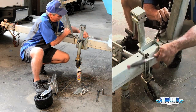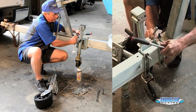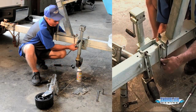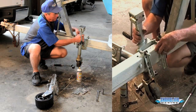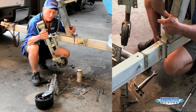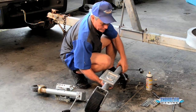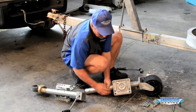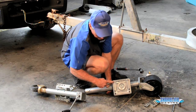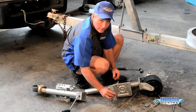Take the old one off — if you just loosen the top ones and take off all the bottom ones, then your jack will lift right off. All you've got to do is find the two bolts and washers that you removed; everything else is together so you can toss it in the garbage. Now take your single hole at the top and your single hole at the bottom, and make sure your U-channel is going to face the outside of your trailer.